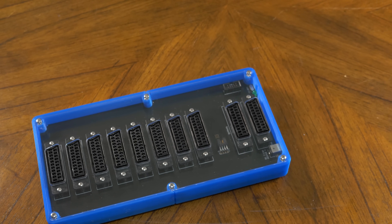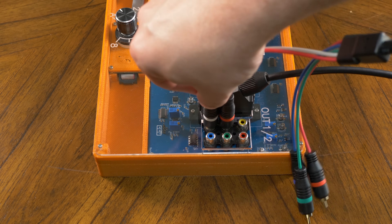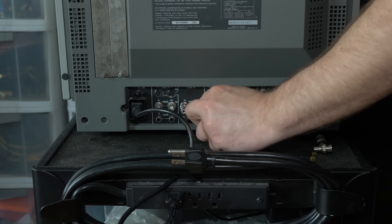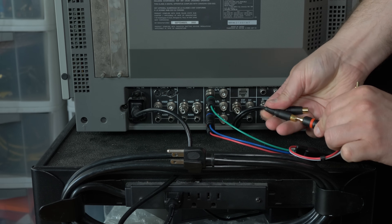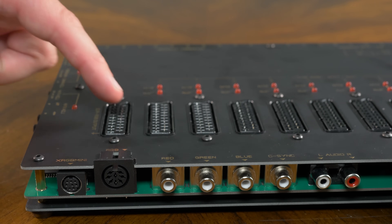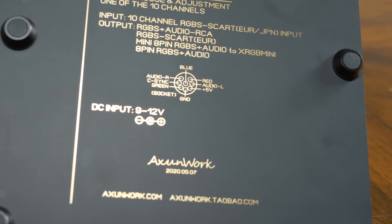Each of these switches offers multiple outputs, but in their own unique way. The GSCART switch has two SCART outputs which can be safely used simultaneously. The Taxon tool switch offers one SCART and one set of RCA connectors for each signal that can also be used at the same time — the RCA connectors can be really handy if you're going into an RGB monitor, as all you'd need is a good set of RCA cables and some RCA to BNC connectors. I just use a set of HD Retrovision cables for RGB and audio, then a single cable for sync. The SCA101 has a SCART output and RCA outputs, but also offers an 8-pin mini DIN wired to the XRGB mini's pinout, and an 8-pin large style DIN with the pinout printed on the bottom of the switch.